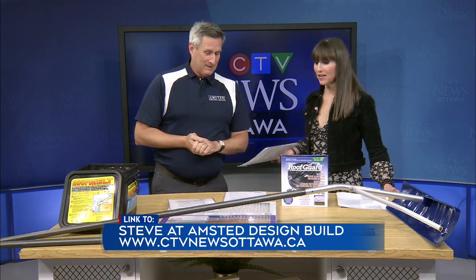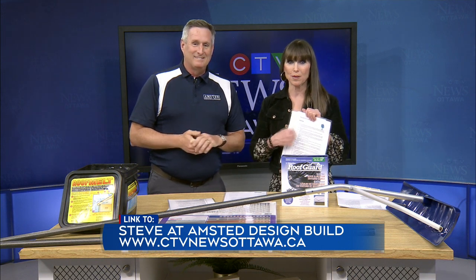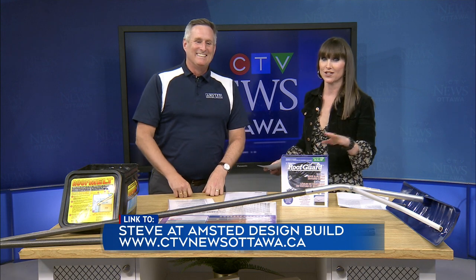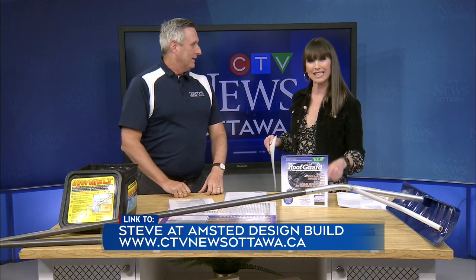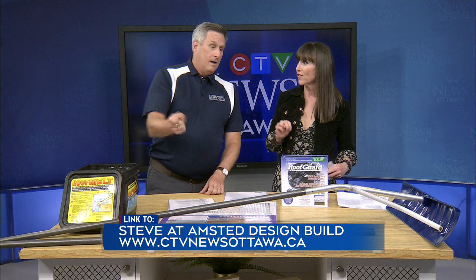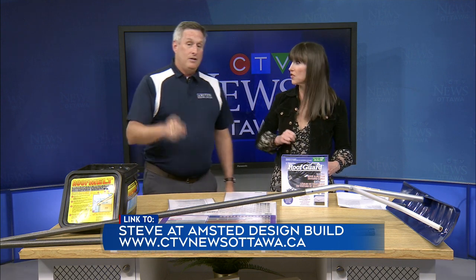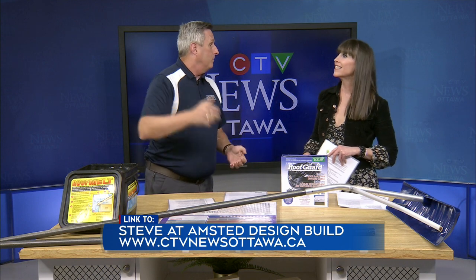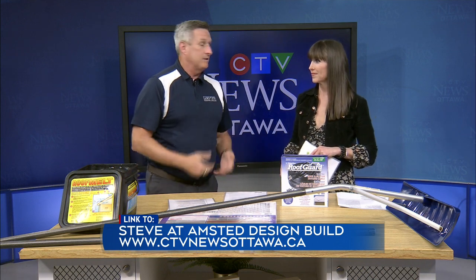Well, we are so happy that you joined us, and I did tease you about using the permanent marker on the checklist, but here's a true confession, and this is my bad entirely. I don't know how many people don't know that the front filter on those front load washers has to be cleaned out every couple of months. Now's the time when you've got the vacuum out doing the other fans, do under the fridge, do under the freezer. Those are the times to do this because they have air filters as well, and they get clogged up because of the dust bunnies.